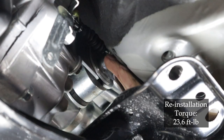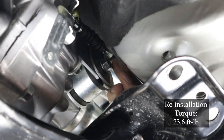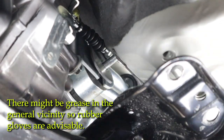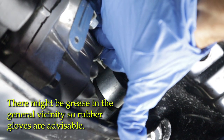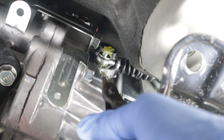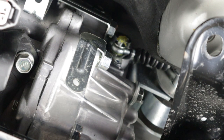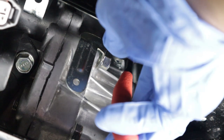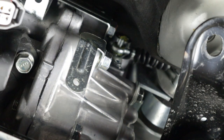Here we have the shifter anchor and the best way to loosen it is by using a 12 millimeter ratcheting wrench. Once it's loose, you can finish it off by hand and then pull it back about an inch or so and then you'll be able to move the anchor down and out of the way. The rear check cable is held in place by a snap pin — grab some needle nose pliers and pinch the folded part of the snap pin and then pull it down. That'll allow you to slide the snap pin out completely. Be careful because behind the snap pin there's a washer so make sure that doesn't fall. Grab both of them and set them aside. If they're full of grease, that's completely normal; if they're not, add some grease before reinstallation.